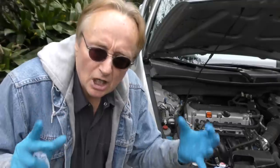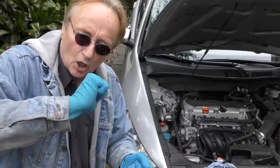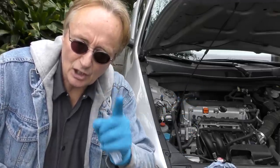getting in the system. Because if you bleed the system the way I'm showing you, by having pressure in the system, open it up, letting it bleed, closing it down, then picking up the brake pedal, pushing it back down, then opening it up again, you won't get any air in the system, because you don't want air in a modern system for one big reason.